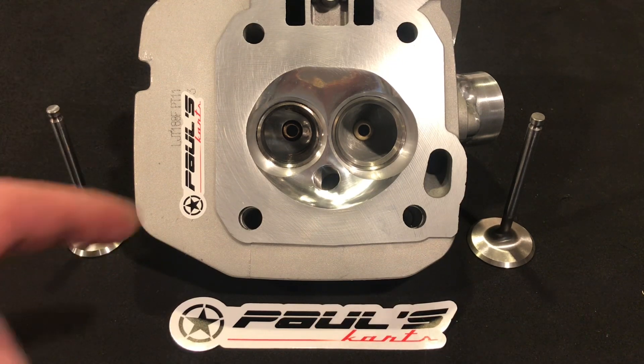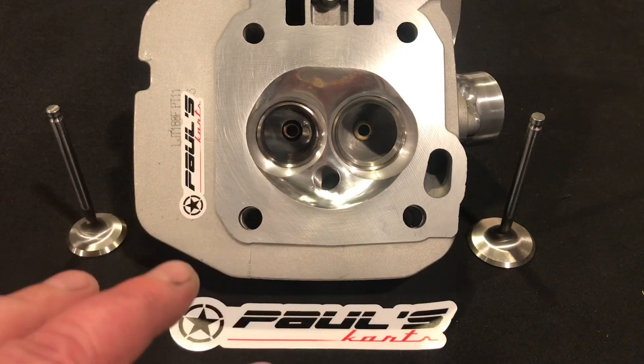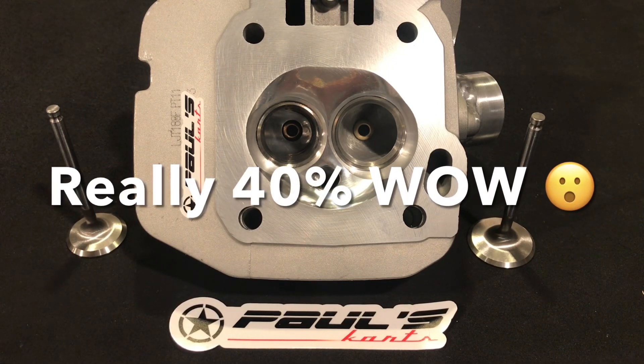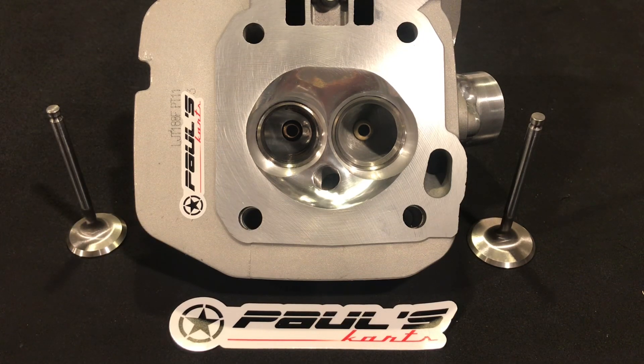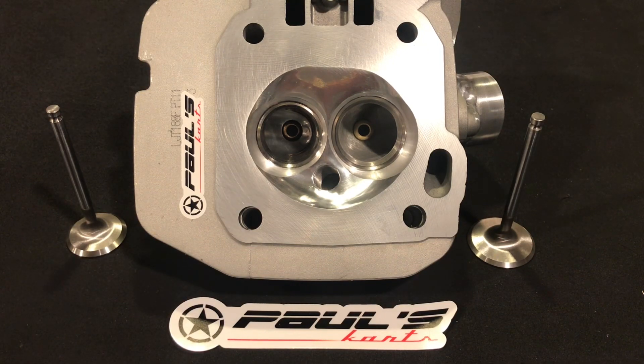When we do our angle valve job, we'll probably start with the 60 just to get some of the seat material out of the way, then come in with our radius cutter and cut the radius into the chamber, and then come in with our 15s, our 30s, the 60 — play that back and forth. Out of the cylinder head, I would say 40 percent of all the time spent on the cylinder head is doing the valve job — 40 percent. So if you guys are porting for a week, you should be taking like two days and a couple hours just doing your valve job alone.